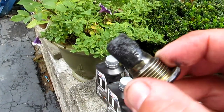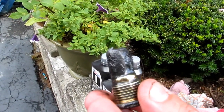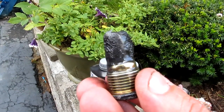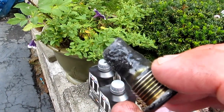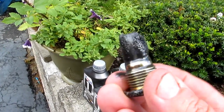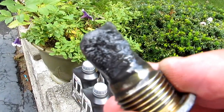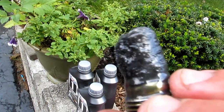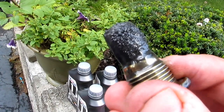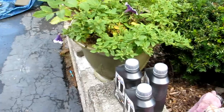That color is not what you want in your transfer case, especially when you don't have a filter or a transmission cooler hooked onto this thing. You can see the dirt filings and everything on this plug — it's a magnetic plug, which is what it's designed for.